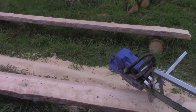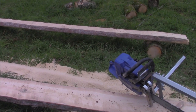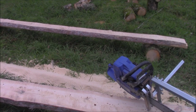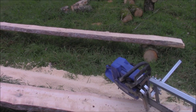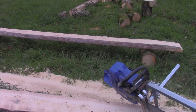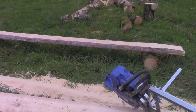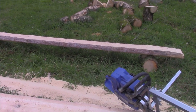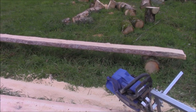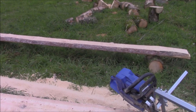Because basically what happens, and this is the 800-pound gorilla in any saw mod type situation, is when you add more gas and air into the situation, you get more heat. To make more power, you have to burn more gas and air. That's what happens, right? Or increase the efficiency of the actual burn through compression. But either way, in order to generate power, you've got to create heat. And then the heat gets turned into rotational motion, right?